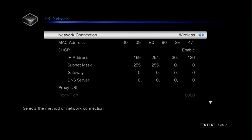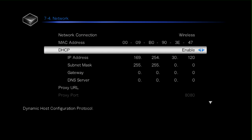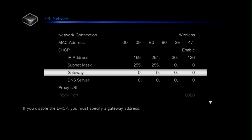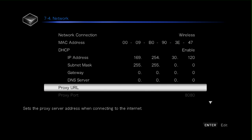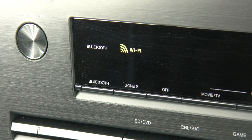This can be done via wireless or hardwired, and we're actually going to be doing this wirelessly. I've set my 626 up to run wirelessly and I'm just running through to make sure the DHCP is set up correctly and it's getting all the addresses. One vital important thing to remember is you need to make sure that the network standby is turned on. If you don't do this, when you turn the receiver off you'll lose complete control. Once you've done that, you just come out of all the hardware setup.